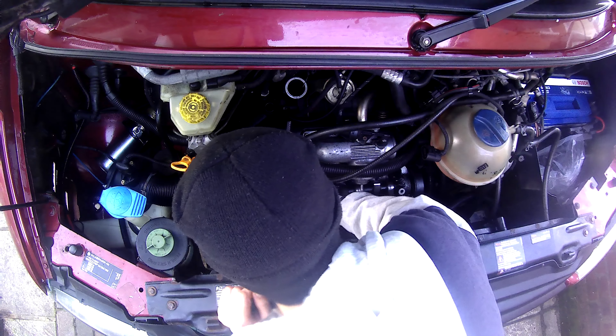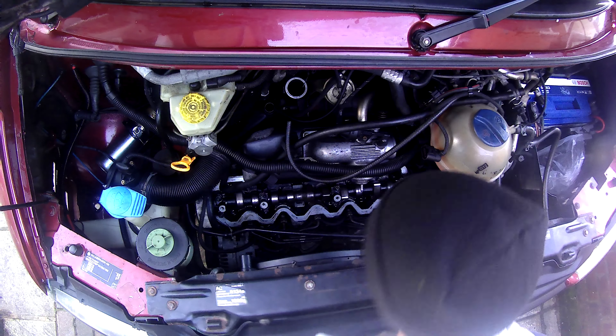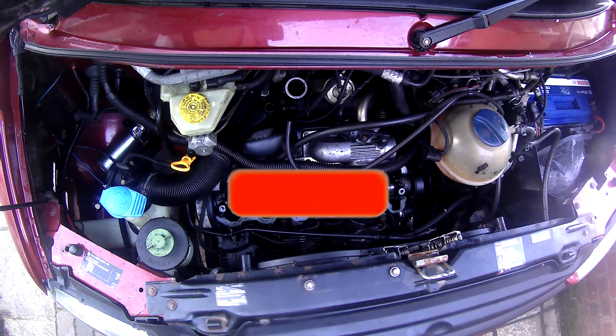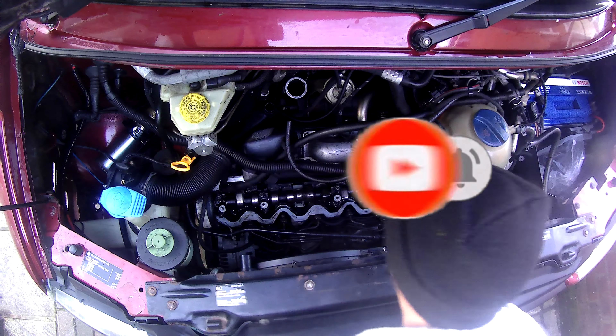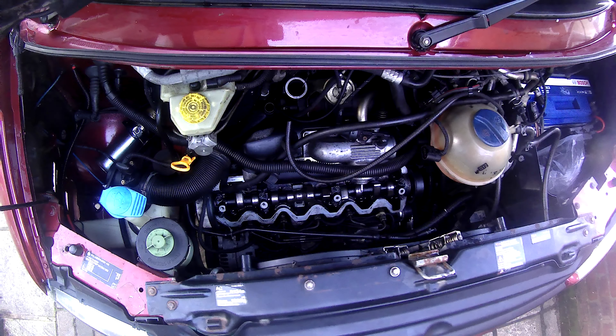I can see with the cam that both lobes on piston one are pointing upwards, so the valves aren't actually engaged — the valves are seated closed and the piston will be very near the top. To get the fine adjustment, this is where I now start using that little peephole. There's a little bung at the top, just above the flywheel, and you can look in there.